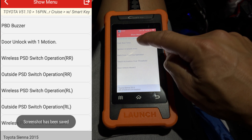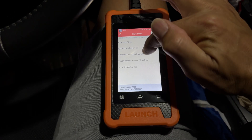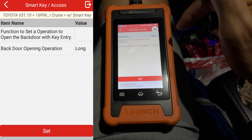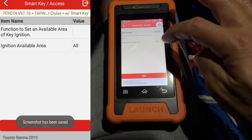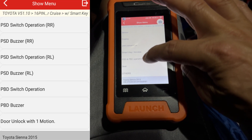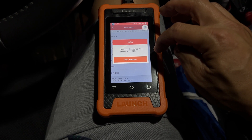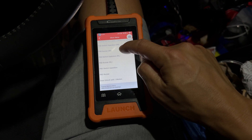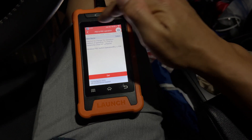Smart Key Access controls different ways to access or turn off all the sensors around the car. You can set the wait time, set each door as active or inactive, adjust the touch threshold — which is the touch over the door handle to lock the car — and set the door unlock mode to all doors or one door. Then there are the power sliding door options, where you can disable either side's power sliding door and control the different buzzers for the passenger or driver's sliding door.